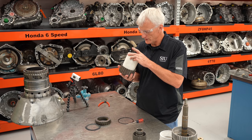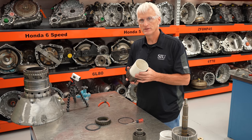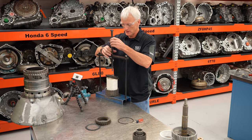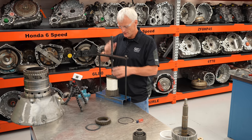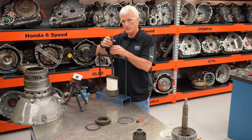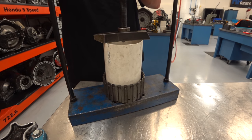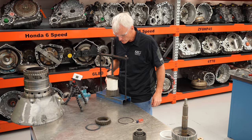So what do I use? You can go to the hardware store and get thin-walled 4-inch PVC pipe. A PVC pipe is not the most structurally sound material, so I wouldn't use it if this piston return spring had a lot of tension — but it doesn't. It's actually pretty easy to move down. This isn't a perfect fit, so I'll have to nudge the PVC pipe around to get access and room to get that snap ring out. I'm using my hand on the screw press — not putting too much force. I can feel I'm pressing the spring nicely. Now I've got room to get that snap ring out.